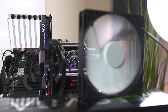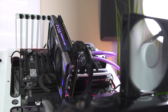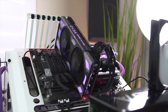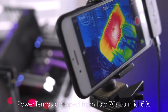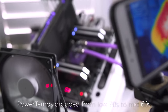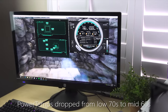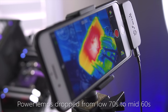That got me thinking about cases — typically there's airflow that moves over the back plate. So I took a 1000 RPM Fractal Design fan, put it about the distance a front case fan would be, and had it blow air towards the GPU. It's not a high CFM fan — just a steady, slight breeze on the back. Temperatures actually came down to match what was showing on Precision XOC, which validated the temperature sensors and made the FLIR thermal camera results completely valid.